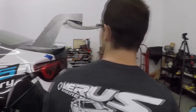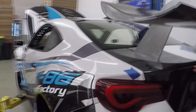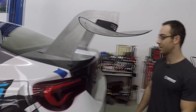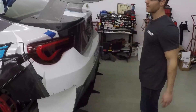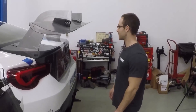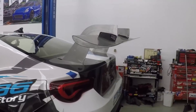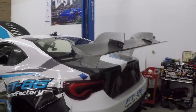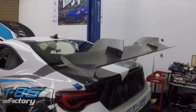At the rear, we cut the trunk. The idea is that the trunk will pull off with a few quick-release latches — you just pull it rearward, and to install you slide it forward and slam it down. Pretty simple, and I actually really like how easy it is. I saw this from Dying to Win on Facebook; he's shown his wing setup multiple times and it seemed appropriate for how we have the uprights going through the trunk.